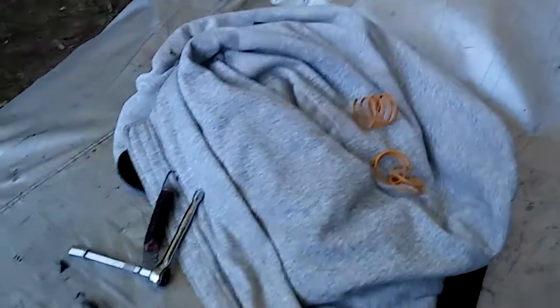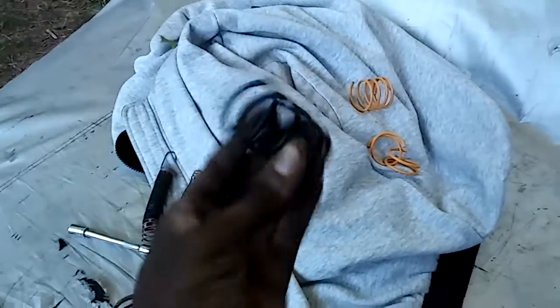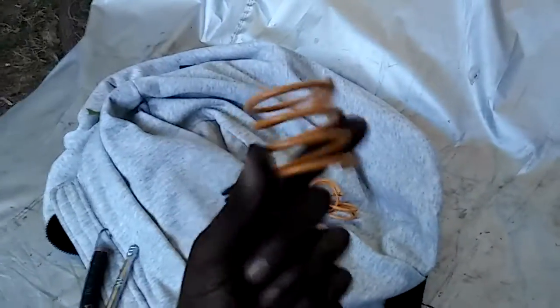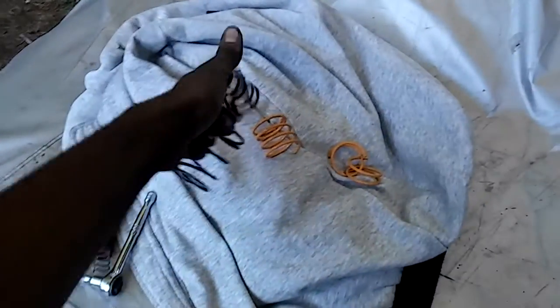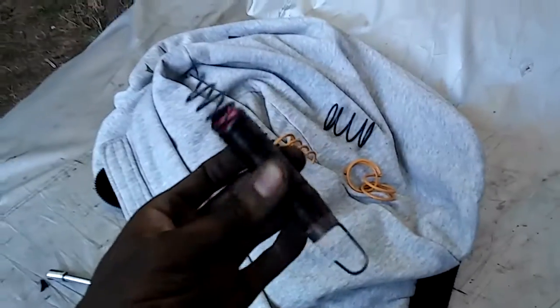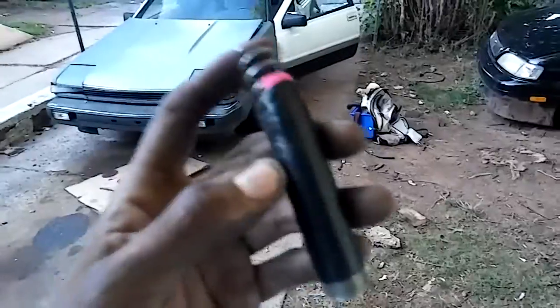This was the spring that was in it before — this one was 10 PSI. Then there is this spring that I put in; I found this in the garage. I'm like, 'Oh, it's smaller.' It turns out this is 15 PSI. I tried every one of these inside of the wastegate. The 10 PSI, that one wound up being 20 once I cut it. This is a 15, this is a 10, and then I found this little door hinge — there was like this much spring. I cut it, put it in the wastegate, and believe it or not, I get exactly 5 PSI.